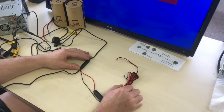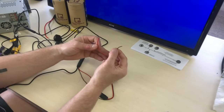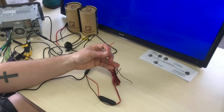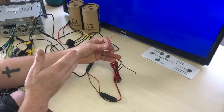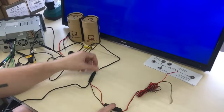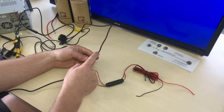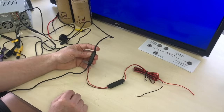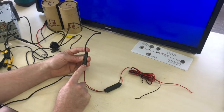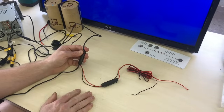The red and black is your power and earth for the camera to turn on. Traditionally when you wire reverse cameras, the black goes to earth — which is any piece of metal on the vehicle chassis — and the red goes to the reverse light trigger on your rear reversing lights. When you put it in reverse, that tells the camera to turn on. There is a fuse here to protect the camera. There is also a voltage reducer inline here — on this particular camera it is a 24V and 12V reducer, so you can have 24-volt or 12-volt input and it will reduce it down to the correct power for the camera.